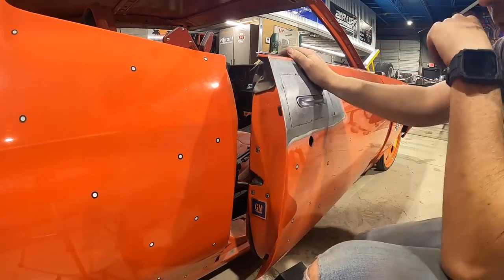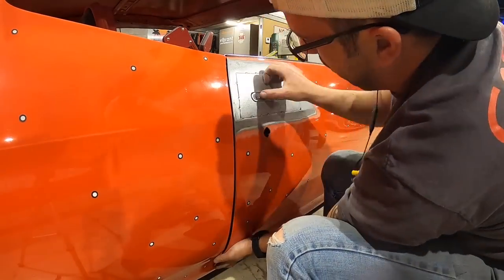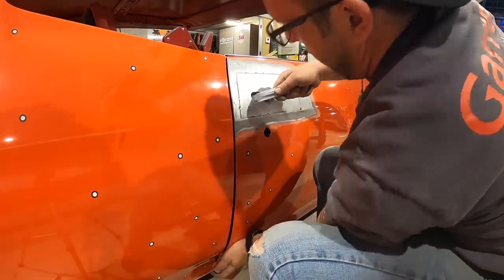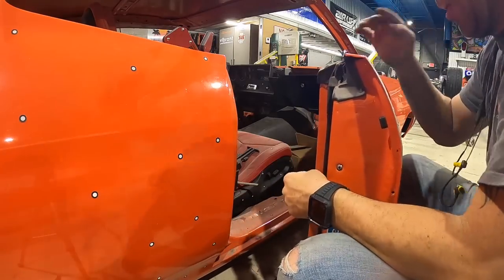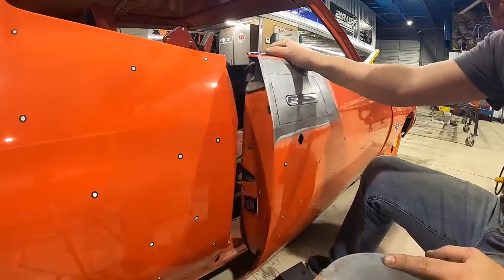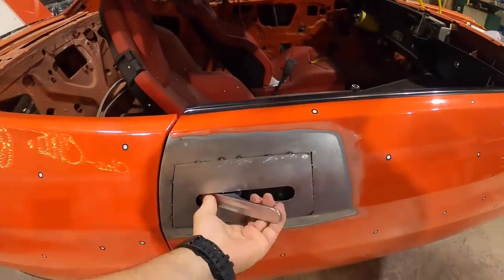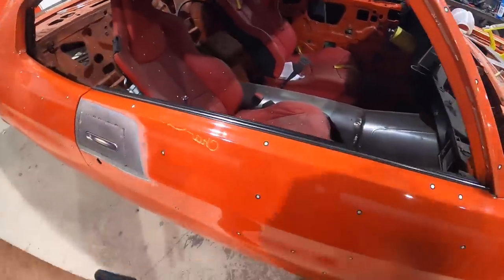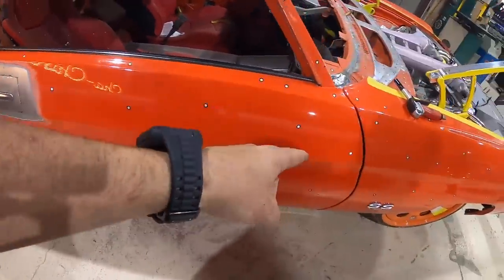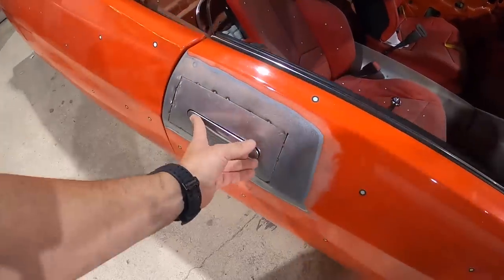This one works, but the issue is the hinge pins. As you can see the whole door is loose — I haven't gotten around to doing that yet, but it does open. The problem is the latch mechanism is catching. I could probably lower that down. That is a wrap on our GTR door handles — the passenger side was pretty much the exact same process as the driver side. Hope you guys enjoyed that time lapse. The passenger side hinge pins are sagging so the door's got a little drop to it — I just adjust that pin and now we have good open and close motion.